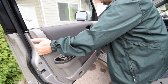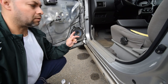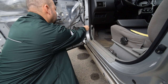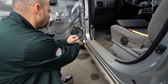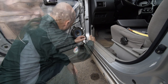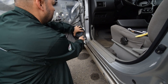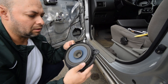Once you've got that done - as you can see it came loose right away - just lift straight up and out, and there is the driver's door panel. Now that we've got the door panel off, we'll remove the speaker. I'm going to unplug the harness here - use a small flathead screwdriver, push that in there and pull straight out. For the actual speaker, it'll have three Phillips screws or you can use your 10mm socket as well. Now simply grab it and pull it straight out. If you've never taken them before, use your panel removing tool and pick an edge you can get into and pull it out.